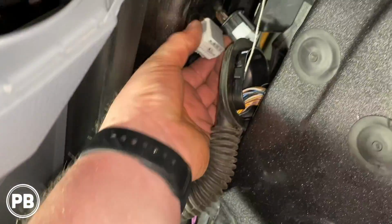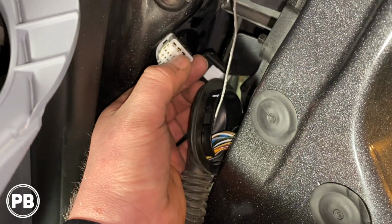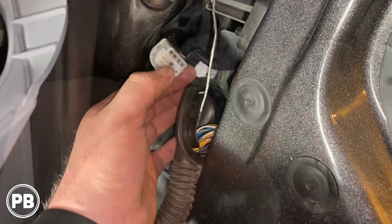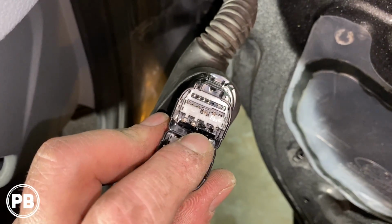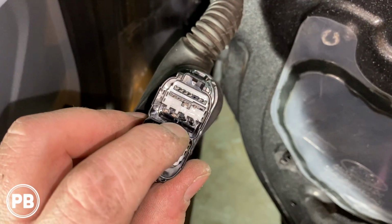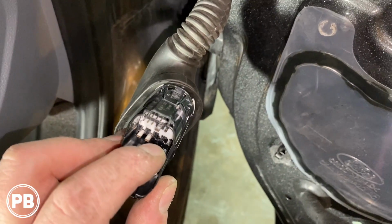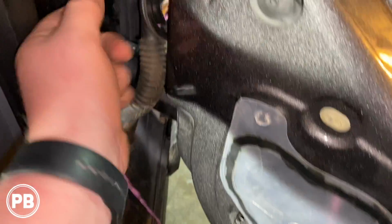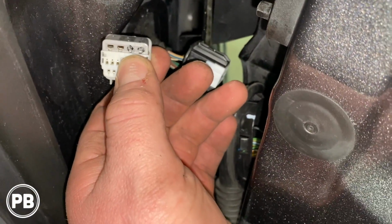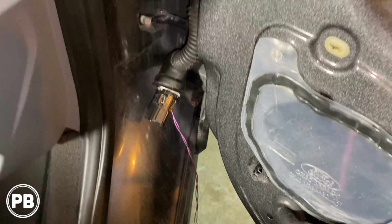Likewise, on the male end, there are two empty slots here that we'll enlarge ever so slightly with the drill bit, so we can pass our wires through there as well. At the end of my finger, we've got the two normal pins for the mid-range, and then the two empty pins over there. I just used the drill bit to make those slightly bigger, because again they pass straight through, so there's little risk of doing any damage. On the male end, again, I used the drill bit to make them just ever so slightly bigger so we can pass our purple wires through. So let's do it.